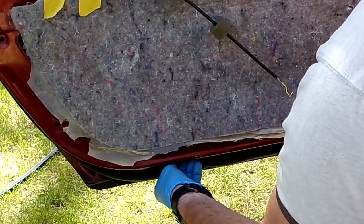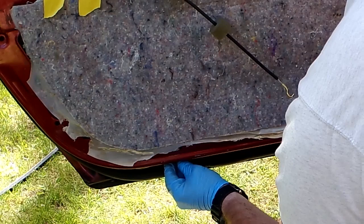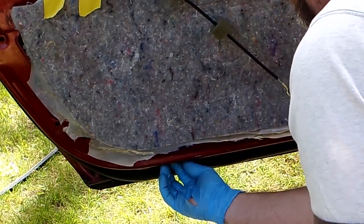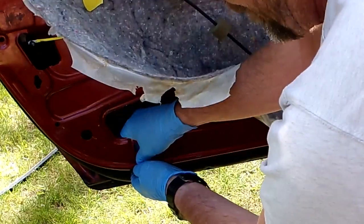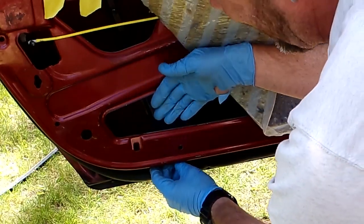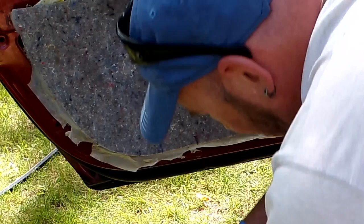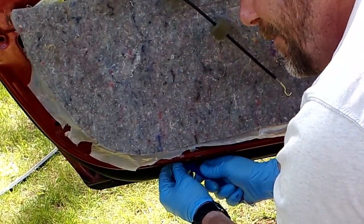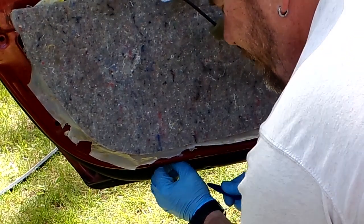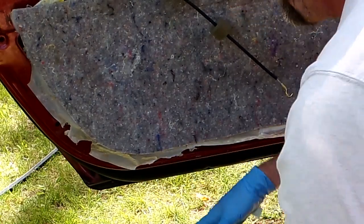And you could just have access to the bolt on the window track and move it. Let's pull these off. I can push them from in here. One, they're just a plastic rubber plug, and I can get to the second one without popping it with a plastic trim tool. Come on off.